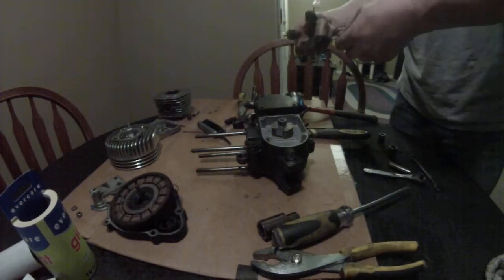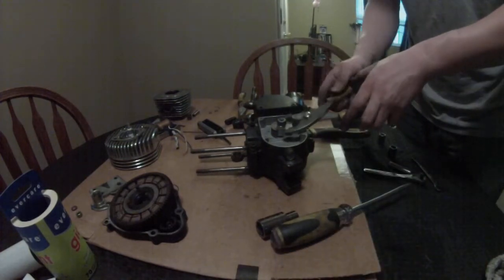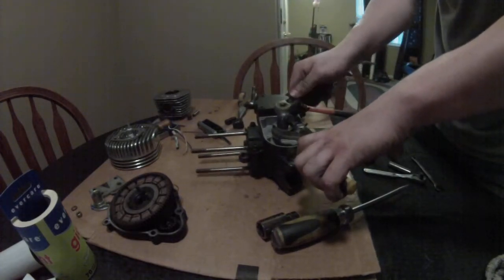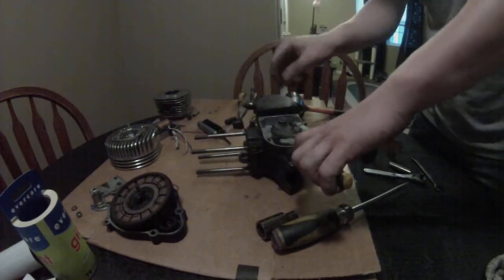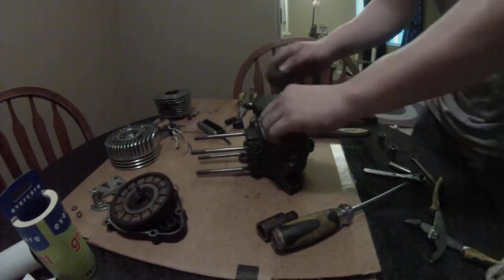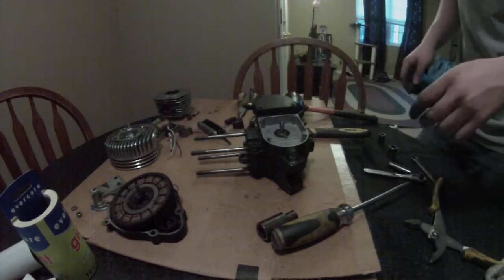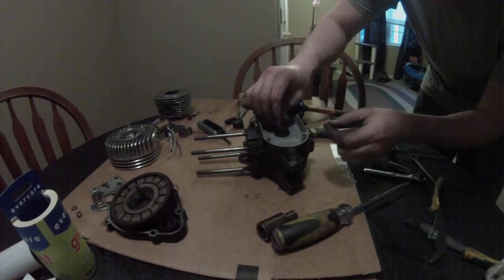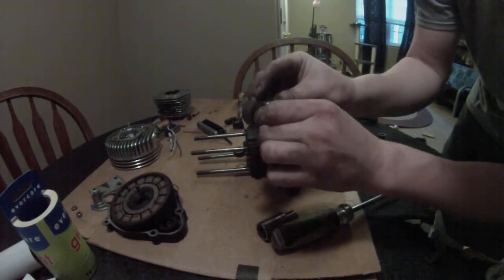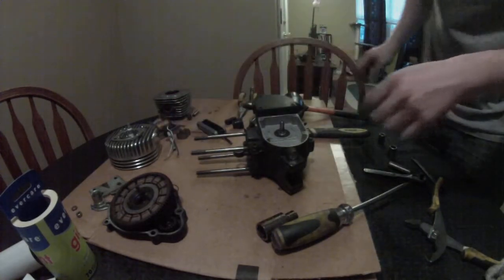Now that you got all that finished, put it off to the side. Take your pair of pliers, hold the side of the magnet, then loosen that nut. It'll come right off and stick to itself so you won't lose any parts. Now everything's stuck together. The woodruff key fell out — there's one right here to make sure your timing's right for your magneto. Watch that and make sure you don't lose that woodruff key.